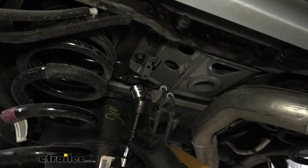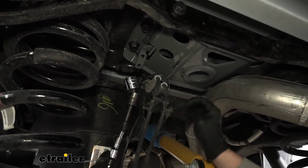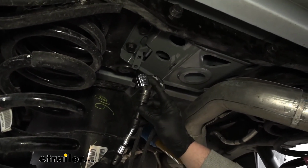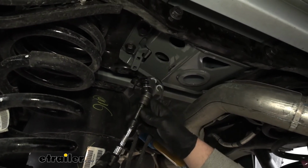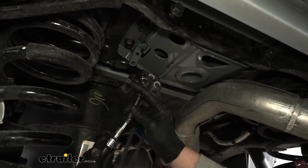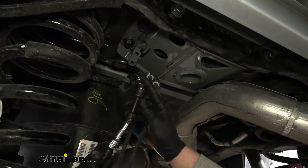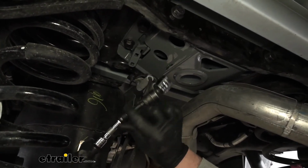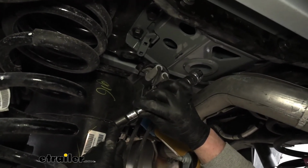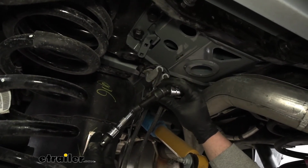Now just kind of a quick tech tip. For the bolt that's all the way back here, it's a little tricky to get to. What I found is to use a combination of different tools here. So I have my socket, a swivel, an extension, and then I actually have an extension that the end of it allows you to rotate a little bit more as well. And I used all 3/8 sizes. It's a little bit thinner. And then I just used an adapter that goes from 3/8 to 1/2 inch. That way I could get my torque wrench on it.